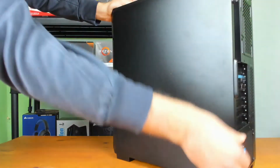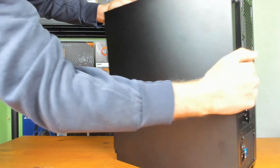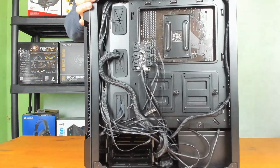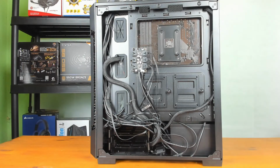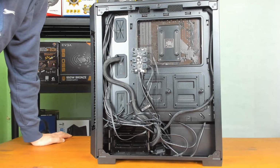Moving to the back panel side of the case, we can see there is ample room for cable management with lots of tie down points and about 1.5 inches of clearance to hide cables behind the motherboard tray. We have a very large CPU cutout, which is very nice to see, as well as the iCUE lighting node core fan controller that can fit up to 6 Corsair RGB fans. Just to be aware that the controller can only fit the Corsair fans and other brands will not fit with this controller, so you are a bit limited on additional RGB fan options with this case.